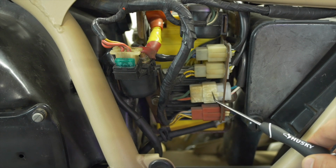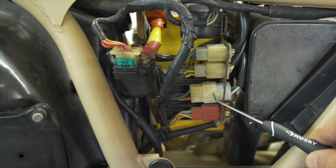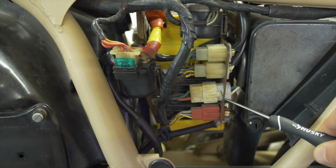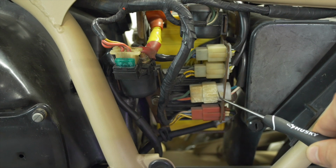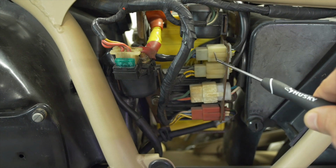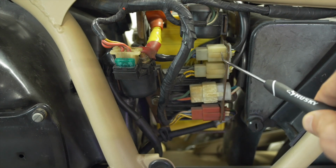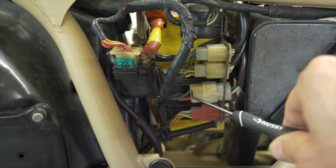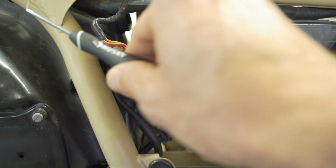The second from the bottom is connected as part of the charging system and is connected to the regulator and rectifier. It's where the regulator and rectifier integrates into the main wiring harness. And the top two brackets are for the CDI boxes, or spark igniters, which are both receiving power from the pulsars, and they're also discharging power toward the coils.